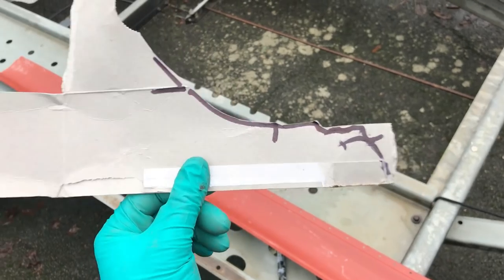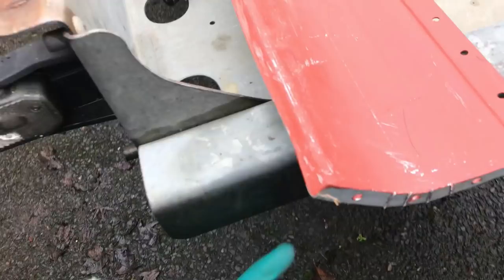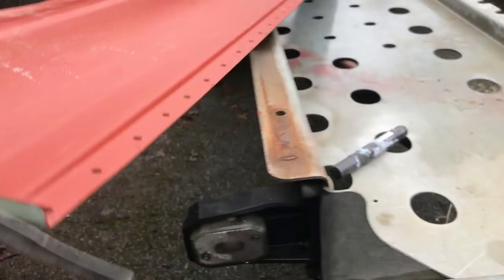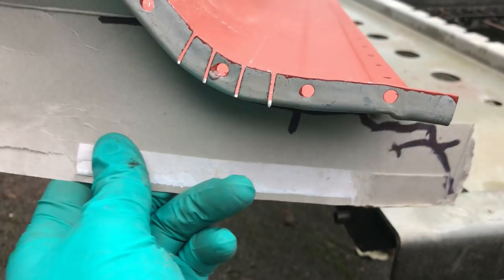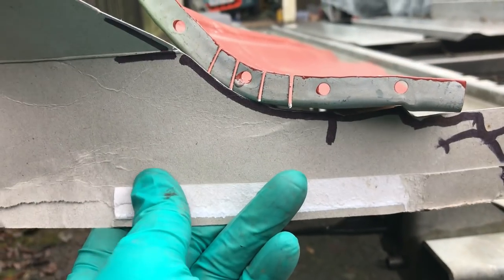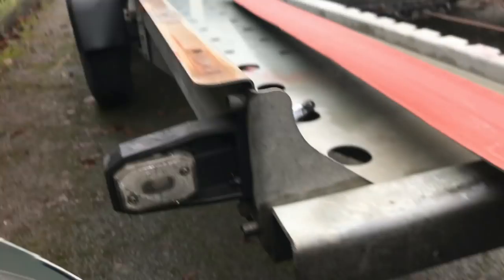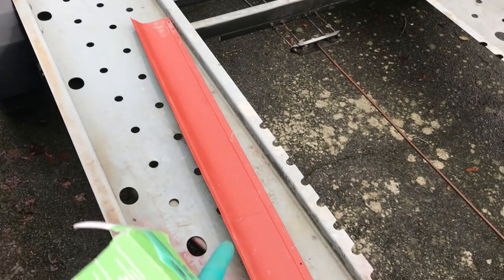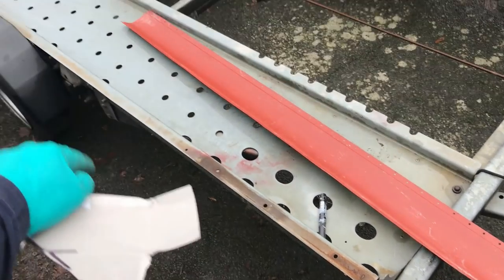Done some good old cardboard engineering to get the profile right. I really needed a template, so that is a template off the seal on the other side of the car which I know hasn't been molested and is correct. I've been using this to get my profiles right on here and balance this properly. You can see it's a lot better than it was - it's still not perfect but the curve is getting there. The front end's pretty good; the rear end and most of it is good. Now I just need to do this section and what I'm doing is just leaning it and folding with my hands over the edge of the steel on my trailer.